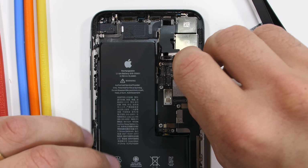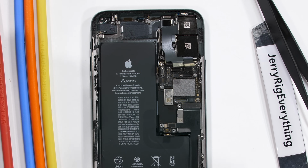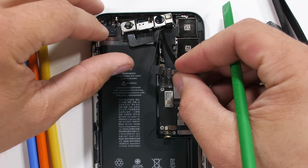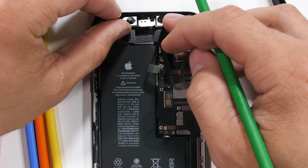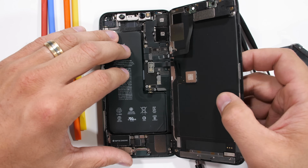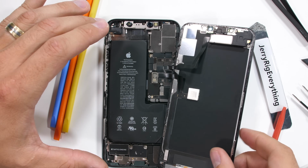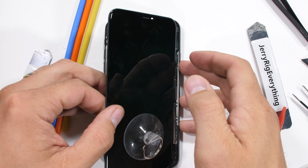I'll get the camera units put back into their slot. They are all housed in the same metal block, so it's impossible to get them out of alignment, and the same thing goes for the front cameras. Finally, the front screen with its 3 ribbon cables can plug into the tiny motherboard, and I can start throwing down all those metal plates over the Lego style ribbon connectors. The last thing that gets plugged in is the battery and its little metal bracket that covers the top.